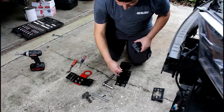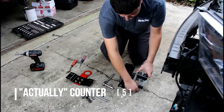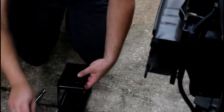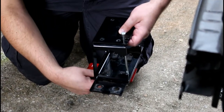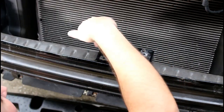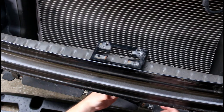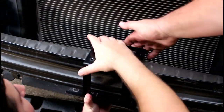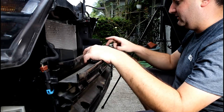Basically it's like a clamp-type thing — kind of hard to explain while holding — but this will go over the actual bumper like this and then slide on like that. These go down to hold it, and then the tow hook bolts like that. It should clear the front underneath the bumper; I don't have to trim anything. So first we're going to put this up here — this fits kind of flush, fits like this, and this bottom one fits under here like that.